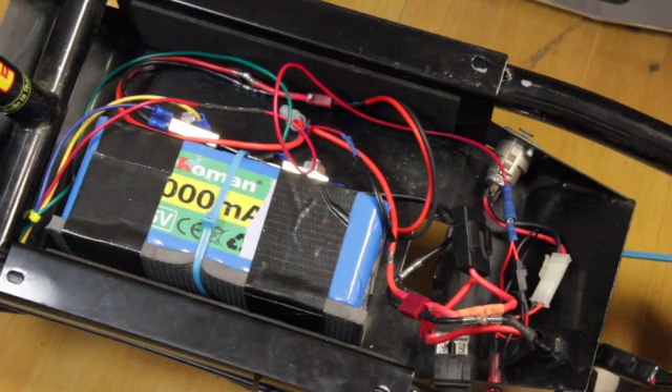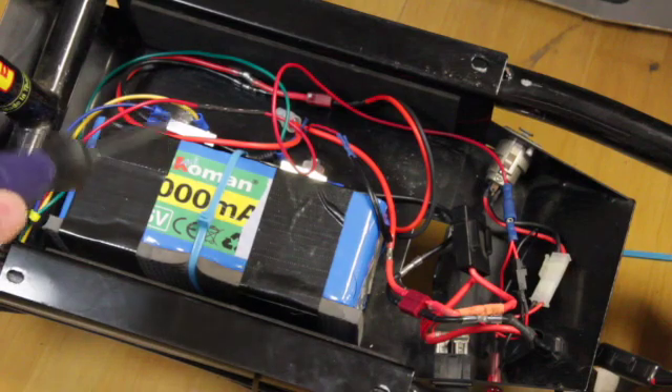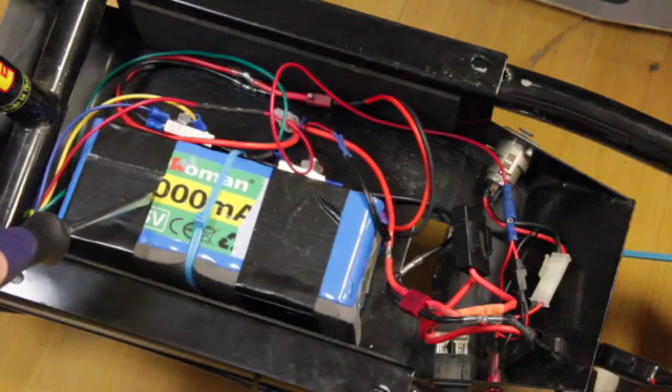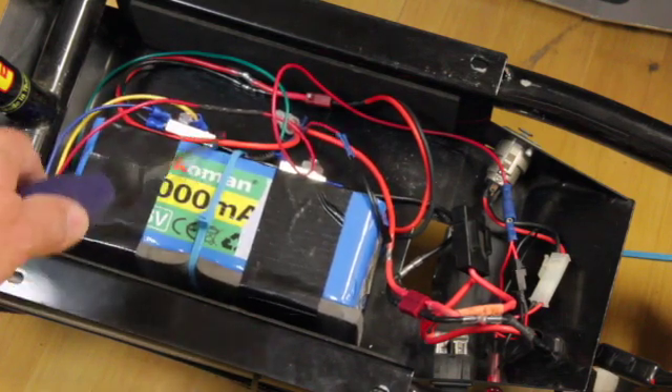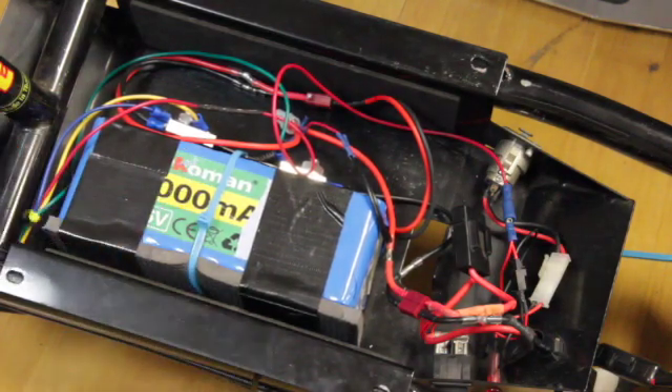What I've done now — take a look at my video on how to install a volt, amp, watt and watt-hour meter on a scooter or e-bike — this is the scooter that I installed that on. So now I can go out and do some real-time riding. With the shunt and the display mounted on the handlebars, I can put this scooter under load at full throttle and see what kind of amperage we're pulling and why the motor suddenly stopped on us.